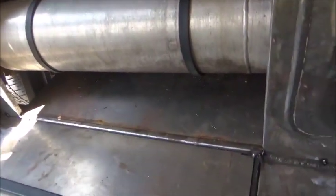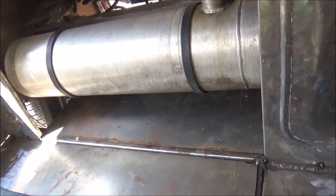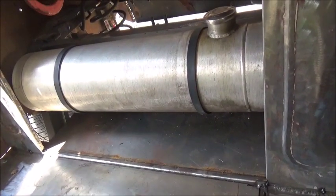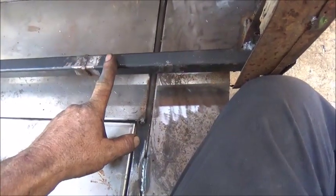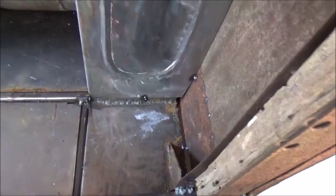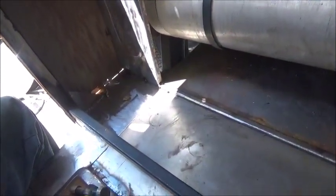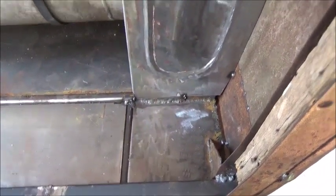And that'll keep our gas tank away from us, and that'll separate us between here and the trunk lid altogether. And hopefully soon I'm going to go ahead and cut this bar out, but once I make sure everything's supported good, this will be our last structure brace that we can get out of there. And this side corner's pretty good. We can put something in there, seam sealer or something. That one's not, because we haven't done the repair panel on that rocker yet in front of the wheel, so we'll keep working at it.